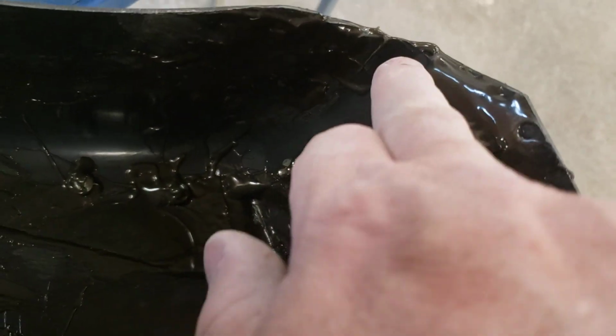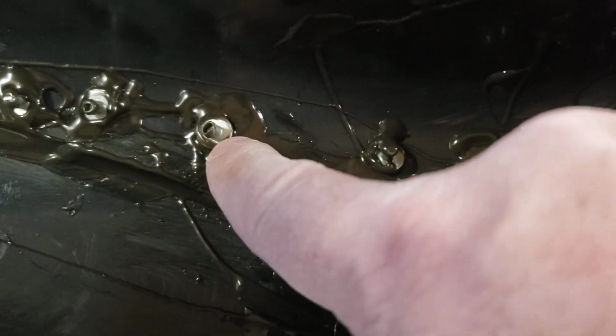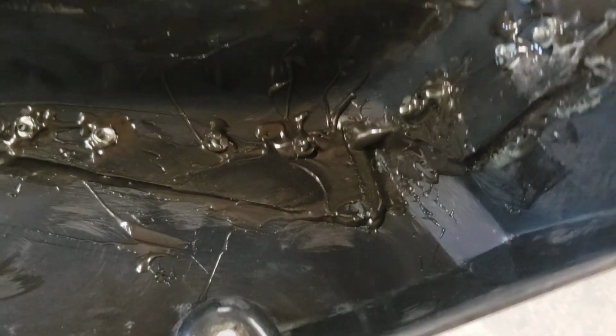And I got the long rivets. Now this is important, especially with plastic. You'll see they look really fat. You can buy washers that fit perfectly over the rivets. So I used long rivets, put the washers in. That'll never move. The epoxy won't let it move. The rivets will hold. And then you see all this extra glue.